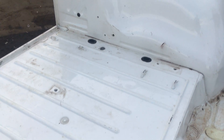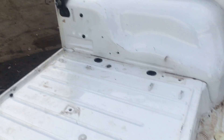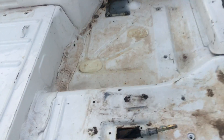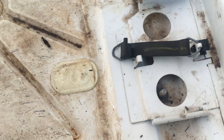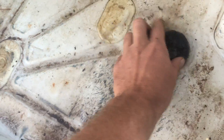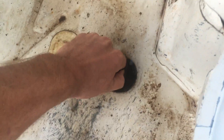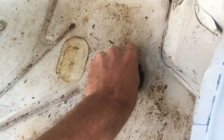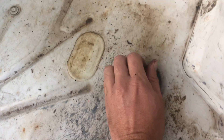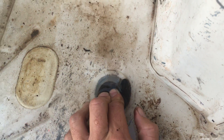Your floorboards are nice and solid. The backside is perfectly straight — sometimes these get ripples in them so keep that in mind. No bolts broken in either one — both in good shape. There's a little bit of change still sitting in it. No bolts broke off. Floorboards are solid. The plug is still in it — you can pull these out and hear the water come out the bottom. I usually have those pulled anyway — it's a bad idea to have plugs in the bottom of the Jeep, especially if you ever have the roof off.